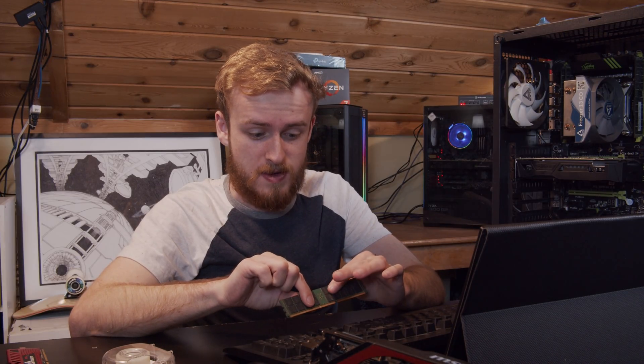I put the tape right here, and yeah, this thing is hot. That might actually mean this RAM is cooked. Let me get this off real quick. It looks like we've already moved past that stage in the BIOS — so I think we're going to boot fine. As I predicted, those two pins in the center of the RAM were important. What happens when you mess with pins in the middle of your RAM stick? You're going to have a fun time. If you remove them from the edges, like if you drop it, you might be kind of lucky. But if you get like your dog biting and chewing on your RAM, you're going to have a rough time.